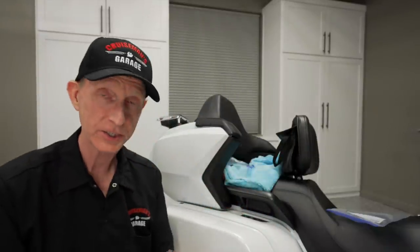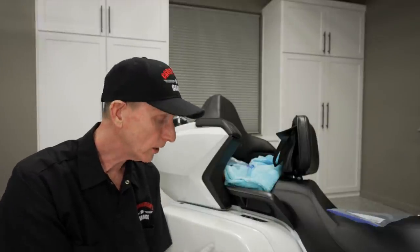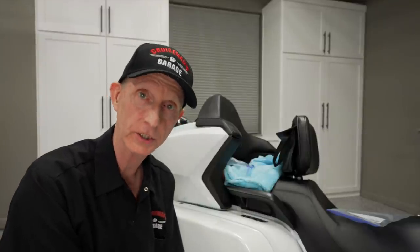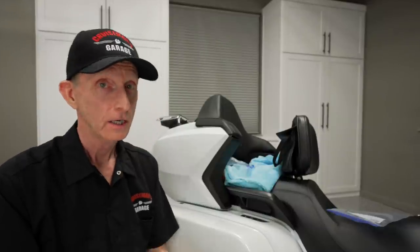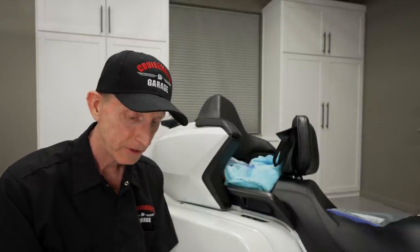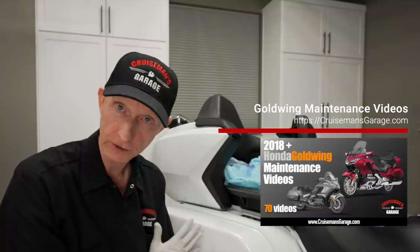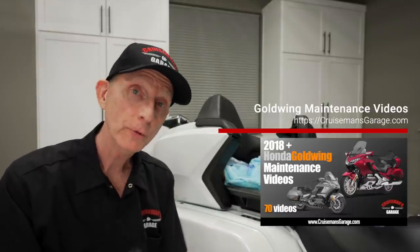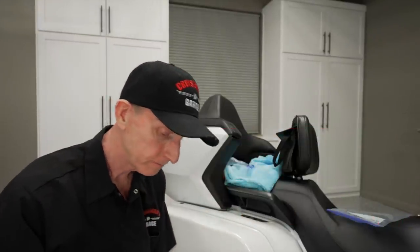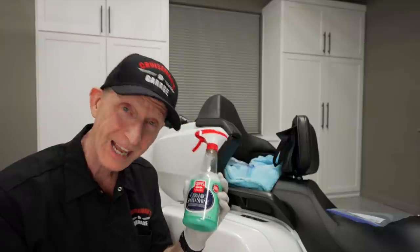So let's talk about why you use this. This clay is designed to pick up contaminants from the surface of your clear coat. As you ride your motorcycle, or even if you just let it sit outside, it's going to get contaminants, and those contaminants can embed themselves in the clear coat. The clear coat is relatively soft. The only way to remove those contaminants is by using something like a clay bar — the clay is designed so those contaminants will actually stick to it as you run it over the painted surface. However, you do need some sort of a lubricant, otherwise it would just stick to the paint as you try to move it. And that's where the Ceramic Speed Shine really comes in handy — it is probably the industry standard for clay lubrication.